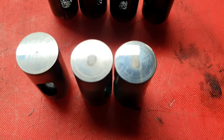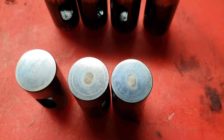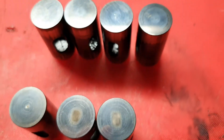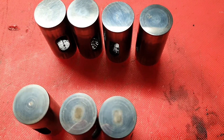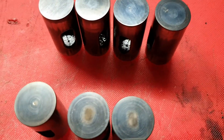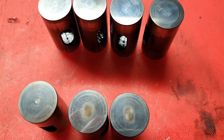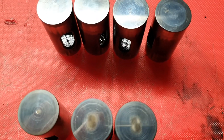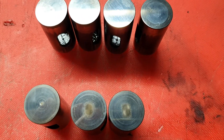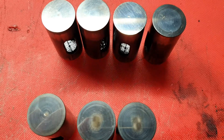This is a moderate kilometer bike - it's a '76, so it's 43 years old. It was very worn in the bores and worn in the cam followers; it hasn't done a high mileage, I think under 100,000 kilometers, but the bores were quite well worn - probably needing second oversize if we were going to re-bore it. I'm wondering if that isn't because the bike didn't see a lot of work and when it did get started it wore quite severely until it got oil all around itself. These cam followers are getting harder and harder to find and more and more expensive.